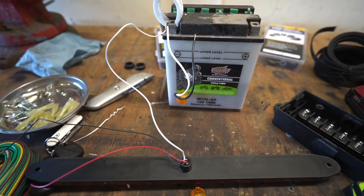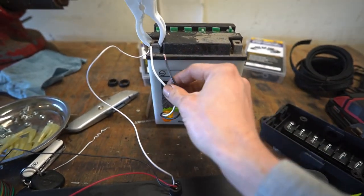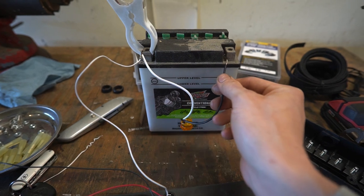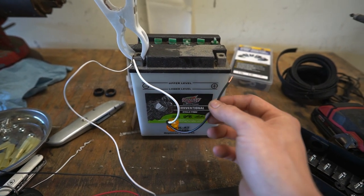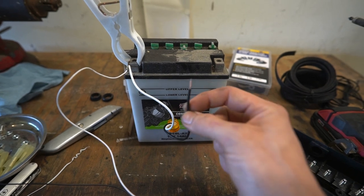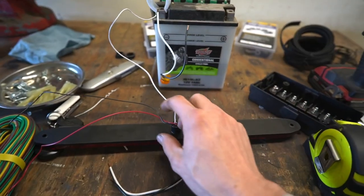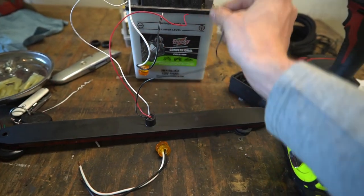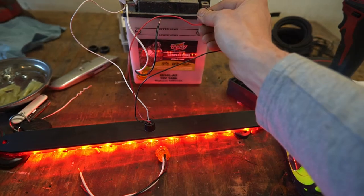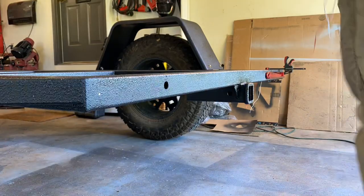With our frame holes drilled, the next thing is to test our lights — figure out what is power and what is ground. In most automotive cases ground is black, but in this case for some reason it is positive, so it's always good to test before you wire it up incorrectly. LEDs cannot have reversed polarity — it has to go the right way. For the tail light: white is ground, black is our running light, and red — which is much brighter — is our brake and turn.